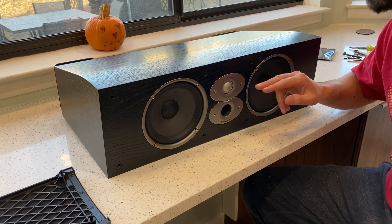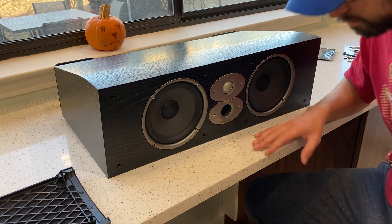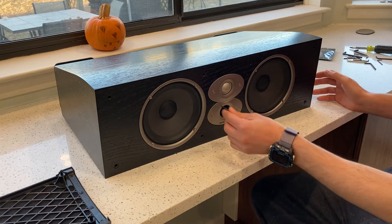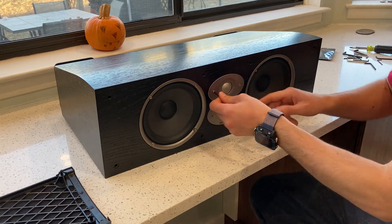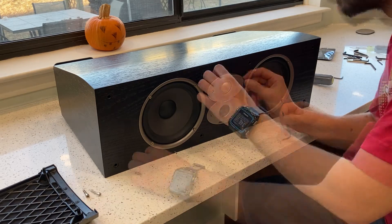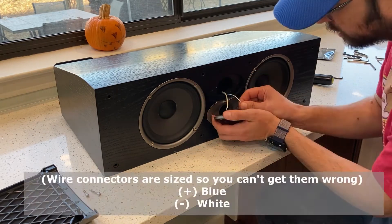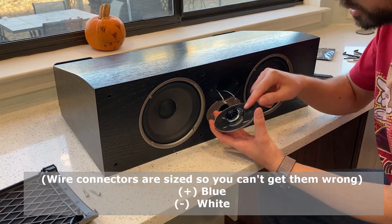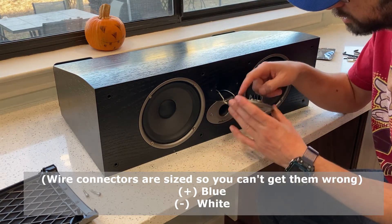You got to be careful because you might get used to it if you don't fix it right away. It's very easy to tell whether your tweeter is working or not — put your ear against it, you have to hear something. To disassemble the speaker, all you need is a set of Allen keys. You can just slide them out. The blue wire goes to the thick terminal, the white one goes to the thin ones.